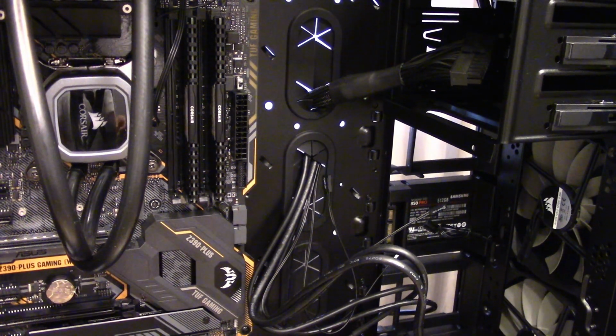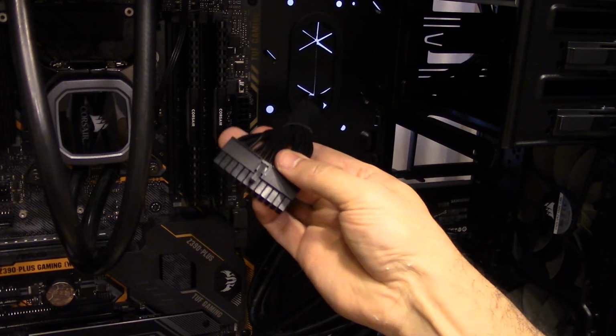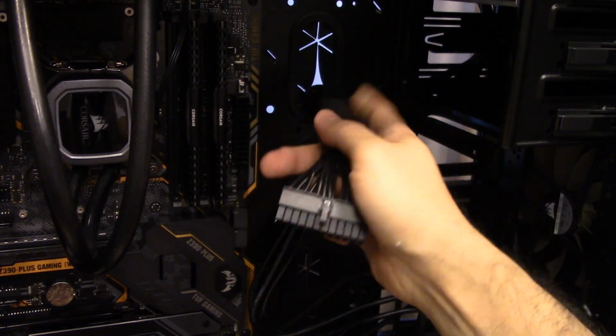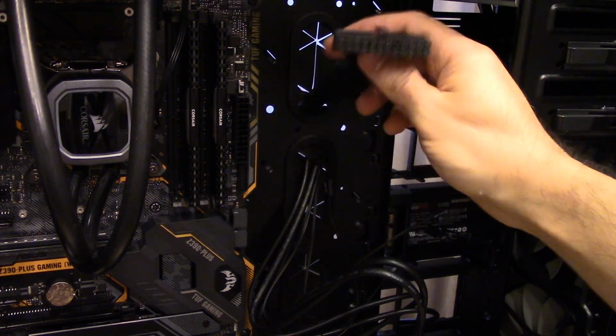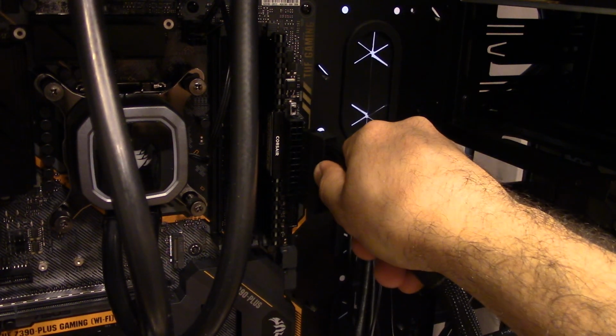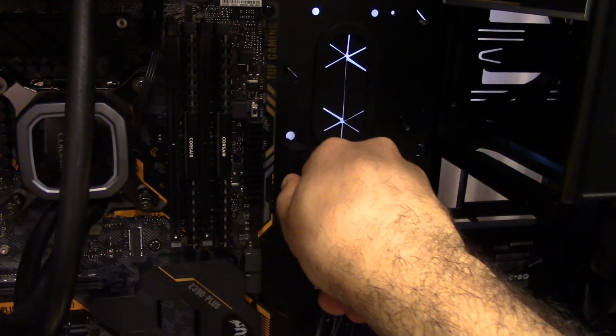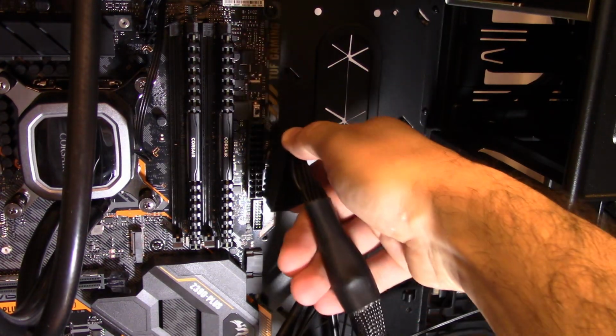The motherboard needs a lot of power, so there is a dedicated 24-pin power cable. I routed that cable from the back, but there is not enough space to plug it in, and I don't wanna twist the cable really much. So I'm just gonna have to route it directly from the power supply without going through the back panel.